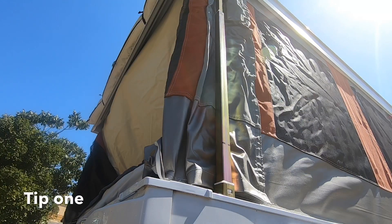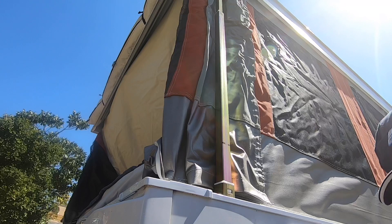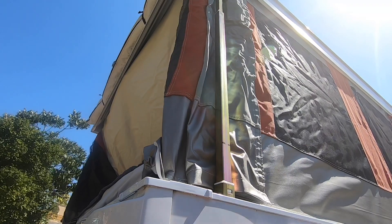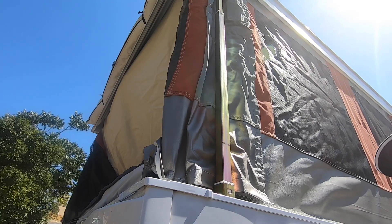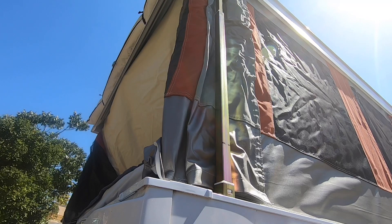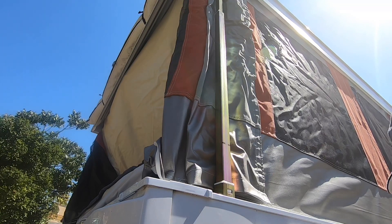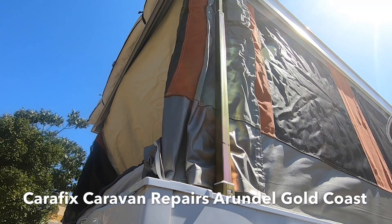What I've done here is I've got the roof up. Before I pull the bed ends out, a small tip I was given by the mechanic who did our first service on our Jayco Swift — and this is something we missed out on at the handover — is your support arms for your roof. When the roof is lowered the support arms go right into each other and fit snugly. But when you lift it up the support arms can raise at different speeds. The mechanic explained that if you don't adjust your roof leveling arms and you get a bit of wind, they can do some damage.